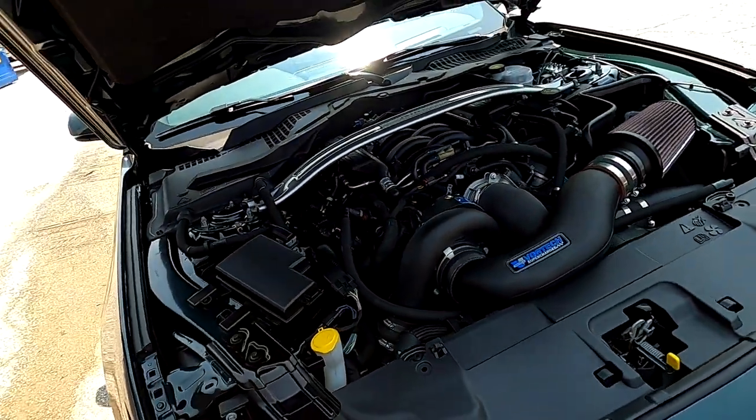I'm pretty sure it didn't leave their shop that way because this thing's been on the road for a while — we're in May, so if that belt was misaligned from the beginning it would be chewed up. It must have just popped off, maybe from accelerating hard, backing off, hitting the gears. The tensioner might have bounced just a little bit and popped the belt off.